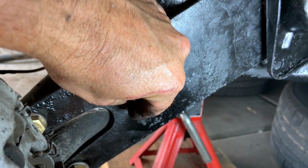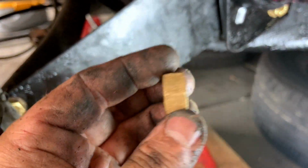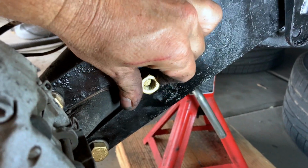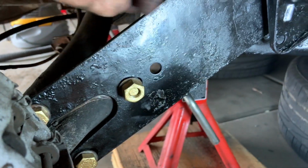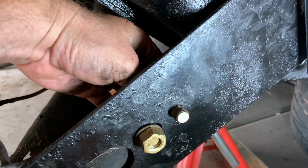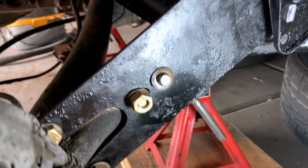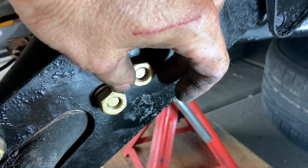I'll grab that washer. Let's put it on there. And remember, it is the bigger of the two nuts and the bigger of the two bolts that go on there. So we'll get this. Make sure I don't cross thread this. Okay. And now let's get in here and we'll do this backside right here. This one, that'll be our toe in. All right, we got that in nice and tight. Throw our washer on, and our thinner nut of the two. Kind of get that going.